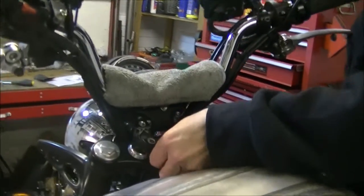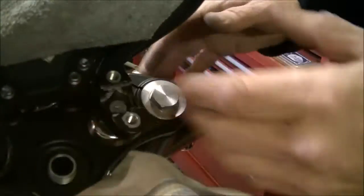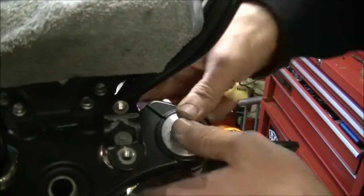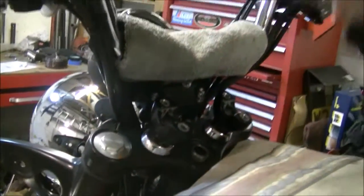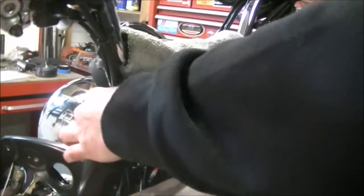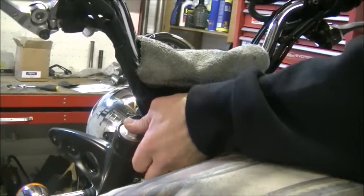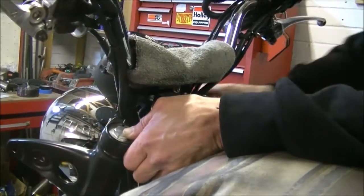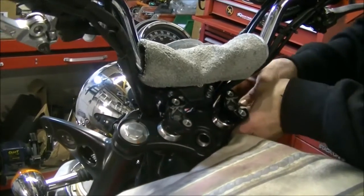Right, now with the washer out of the way as well, that is now ready for the top yoke to come off. Right, fingers underneath the yoke. Once everything's undone, don't go forcing anything, don't lever against anything, just 2 thumbs on top, 2 fingers underneath, and you'll get a little each side and it'll come up like that. There you go. Obviously, people like Johnny Cactus, who takes his top yoke off every Tuesday, his one probably falls off, but yours will probably be stuck. You get little bits of it get jammed on. It's coming.